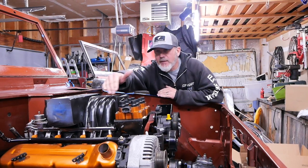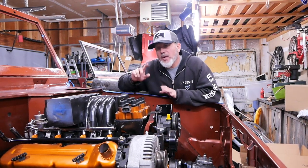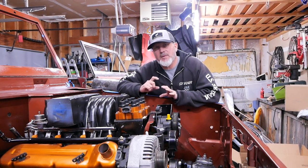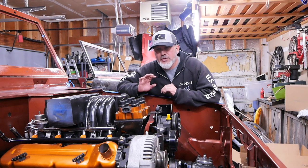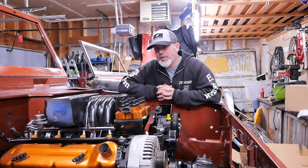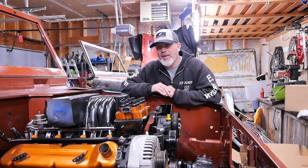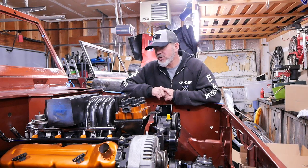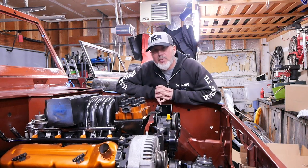Fast forward to the future, and you can see that the fuel rail is installed and the 19-pound injectors are spraying beautifully. One note I didn't mention earlier: when I finished cleaning them, I actually went ahead and put the WD-40 back in there and exercised them a few more times just to make sure the injectors were not going to stick again. So now they're good. I've got fuel lines ready to go, hooked up to the new gas tank setup we're going to put in this. Once we get this completed, we're going to do a baseline — go to a dyno and do a baseline power run — and see if the 19-pound injectors are actually keeping up with the motor. If they're not, we'll switch to a 24-pound injector, maybe even a little bigger than that. I wanted to see what these 19-pound injectors would do for a mild 347 build. That's a wrap from Alpine Garage. Continue to follow us on the building of this '73 Bronco, and we'll see you in the next video.